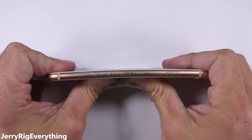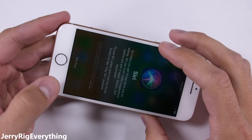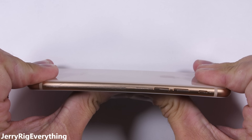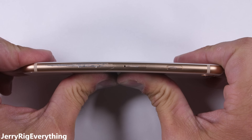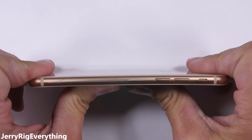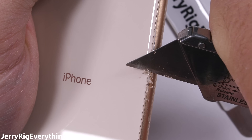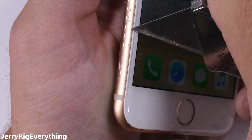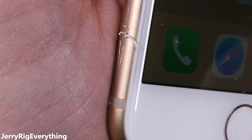Speaking of things to not try at home, it's time for the ultimate test of durability — the bend test. Nothing stresses the construction of a phone like a bend test, and whether you're an Android fan or an Apple user, everyone can appreciate a well-built phone. This is indeed a well-built phone — there is zero flex to this device. On my iPhone 7 bend test last year, the waterproofing adhesive was ruined by the bend, but this has since been corrected with the iPhone 8. There is no glass separation on the front or the back no matter how you bend it. As a bonus, the rear glass panel has a lip of plastic around the edge as a cushion to protect the glass during drops, and the front screen also has a plastic cushion around the glass — most people wouldn't notice this subtle detail, but Apple puts an extraordinary amount of thought and design into their phones.